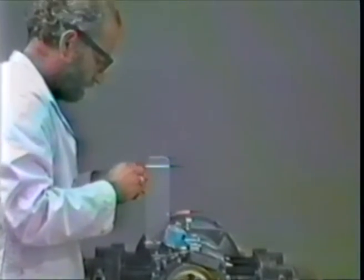You want to get out your Ford water pump sealer. Works well for this purpose too. And coat both sides of the insulator block. There is no gasket between the insulator block and the case. It is in fact its own insulator block, is its own gasket. So you put some mucilage on both halves, both where it's going to seal against the case and the fuel pump. And then you put it back on, making sure you put it on the right way.